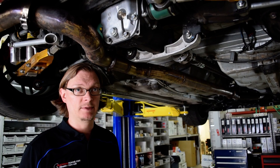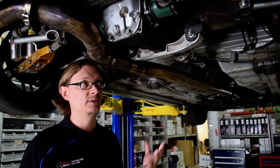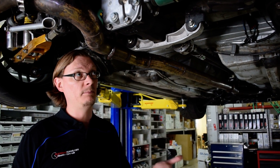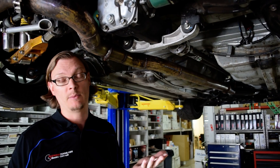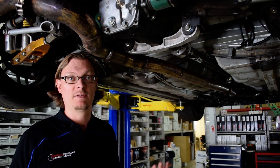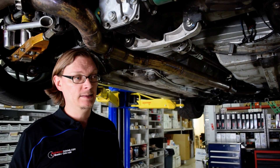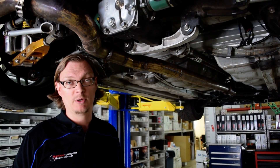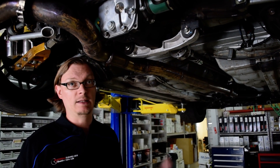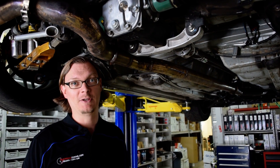Beyond that, you just need to put in a center diff controller. It's really that simple. If you retain the axles and hubs up front, and use an STI axle and STI R180 diff in the rear, the swap is actually very simple and a lot more cost effective than it would seem. Because you don't have to worry about brakes — we're still running the R160 parking brake, still running 5x100 bolt pattern, and WRX suspension. You don't have to change any of that out. It's much simpler than it might be made out to be on the internet.